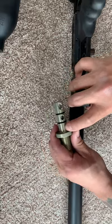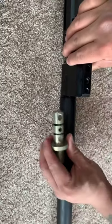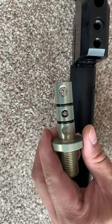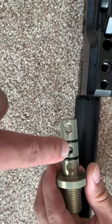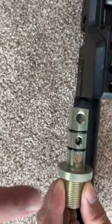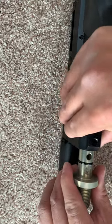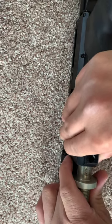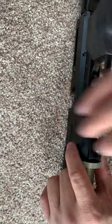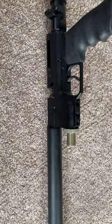After that's done, just plug it back in — that will solve the problem. Or you can wait — we're going to have new valves manufactured, and we'll send you a new valve. All you need to do is replace this valve, replace the whole part. When you plug it in, remember to face it up, and also check those two O-rings.